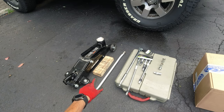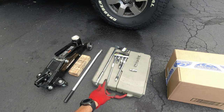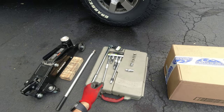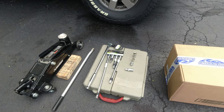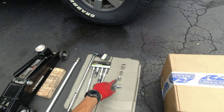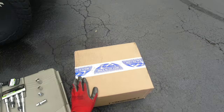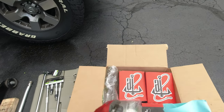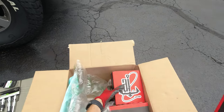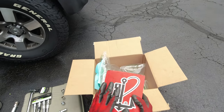For the job we're gonna need a jack with a piece of wood, some long extensions about 24 inches in total, a breaker bar or ratchet, a 17 millimeter socket, and a 14 millimeter socket. I also might need two adapters. I went ahead and ordered some parts online — two brand new engine mounts. The third part is a transmission mount which we're not doing today; that's for the next video.